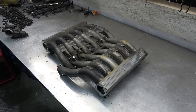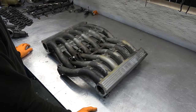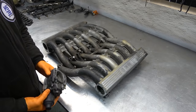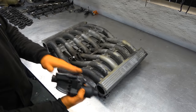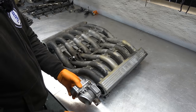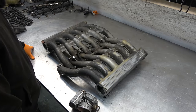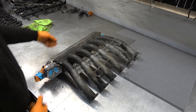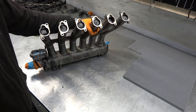Now quite possibly the most satisfying part of this restoration — cleaning up these intake manifolds. They are aluminium so they're going to look spectacular after vapor blasting them. The throttle bodies are also aluminium on the housing and will look spectacular as well, but there's electronics, gears, and water in the machine so we're not going to blast the throttle bodies. Instead I'll use an old non-working one to close the holes and minimize the amount of media that goes inside. I've blocked everything up including a little sensor on the back and put foam in to minimize blasting media entering.